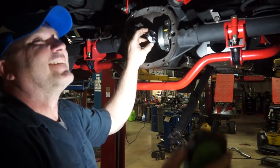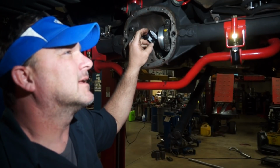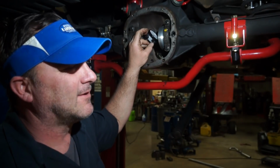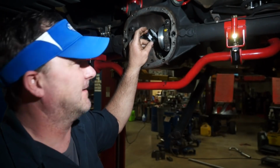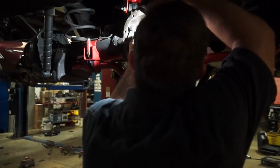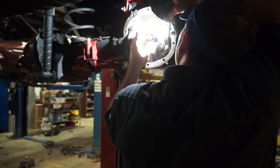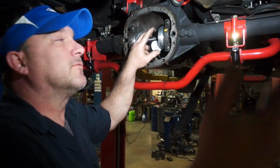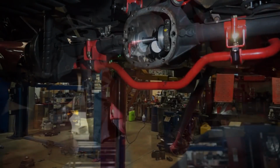I went the wrong way. 93. Why is it less? So I need a 28 thou shim instead of a 26 thou shim because I'm a dummy. That's pretty funny. But it did move me my 2 thou. Just moved it the wrong way.